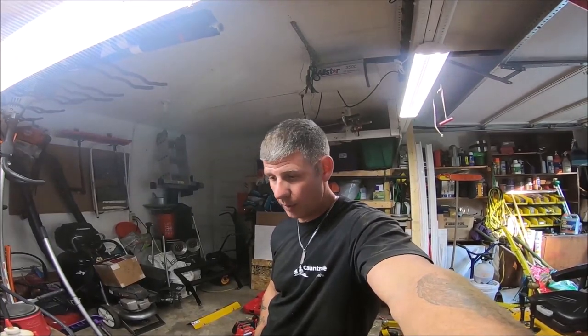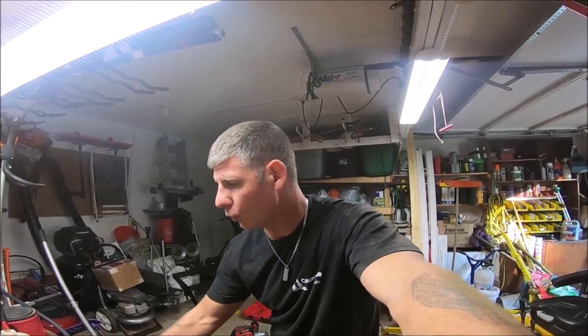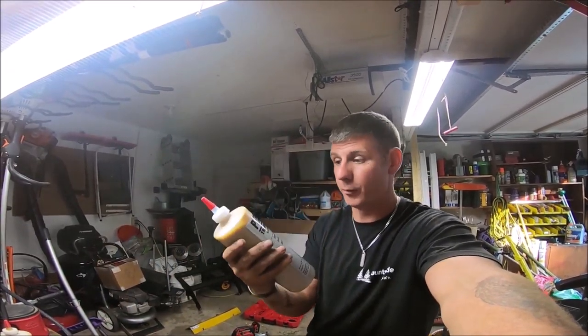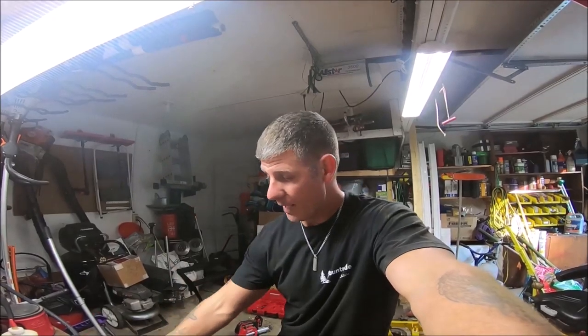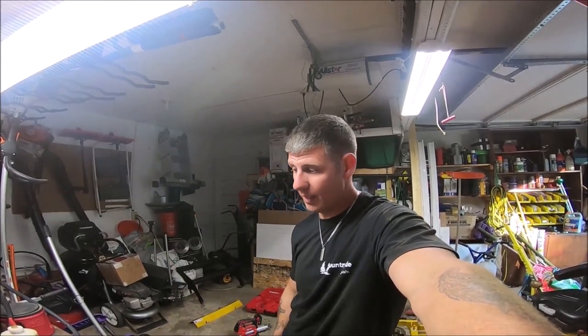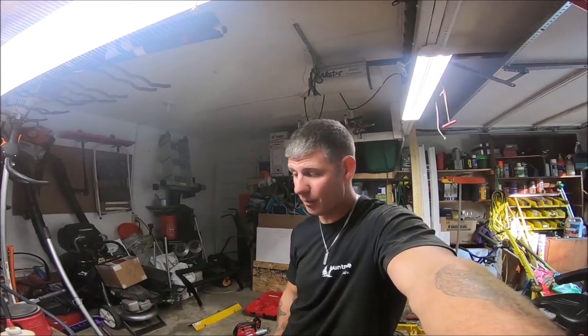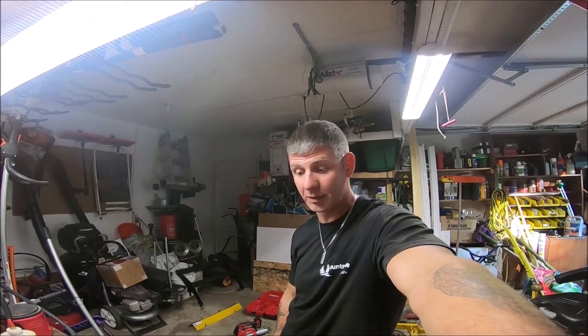I don't know. We'll see what happens over time. I'm going to run it for the next few days and we'll see how it goes. Somebody told me to run this stuff, bentonite grease, for Peerless transmissions, and it's a lot thicker. I did put that in there at first, and then I took it back out because they were really quiet, but it was super thick that I don't think it traveled all the way through the tubes to get to that center box. So I cleaned as much of it out of there as I could and put the regular gear oil in there that all these gearboxes call for.